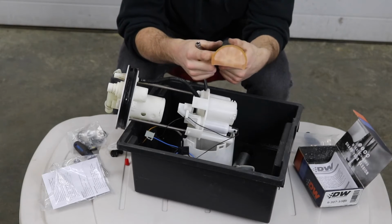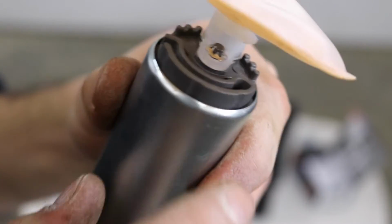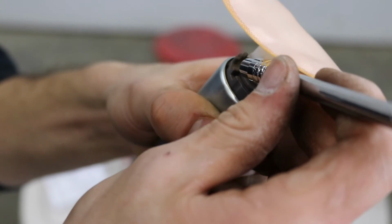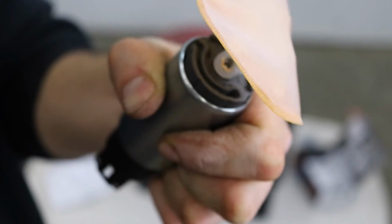All right, I ended up getting this clip pounded onto the sock off camera. I'll show you guys what it looks like nice and close up to the camera. You can see the clip right there. We got it pounded on. We just pried this sock up. I set the little metal ring on there, took a 5.5 mil socket, set it over top, and then whacked her a couple times with a hammer, got it on there, and then just used a flathead screwdriver to pound it on and even it out.